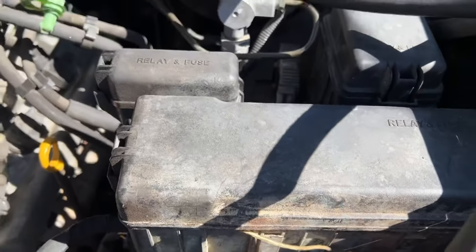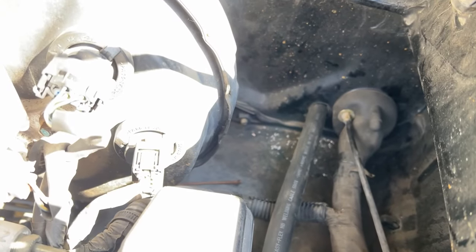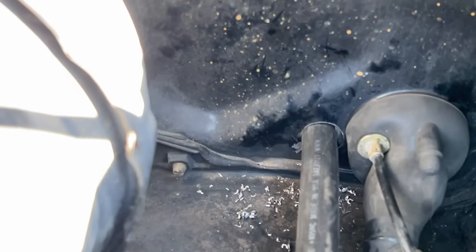But basically, I had to drill a hole to get it into the cab. Didn't want to, but this is what it is. I kind of oversized this slightly, but it's better than scratching the shielding as you're bringing it through. Slightly oversized, you see. But that's good. I'll put some silicone around this, so I'll go ahead and tape it up. Silicone the bottom, fill it nice and tight. And once it dries, I'll slide it down and then seal around the rest.